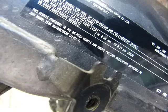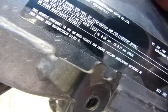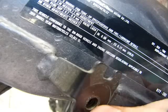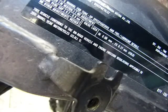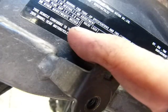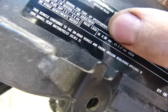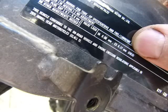To get started with a valve adjustment on a 2011 Honda CBR125R, I want to point you at this sticker, which is right underneath the gas tank. We are underneath the body panel with some body panel parts removed. You can see the following numbers here: valve lash — that means valve gap — intake IN: 0.06 millimeters, exhaust EX: 0.27 millimeters, in brackets, cold.